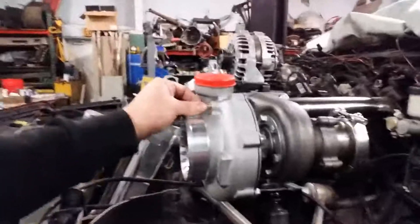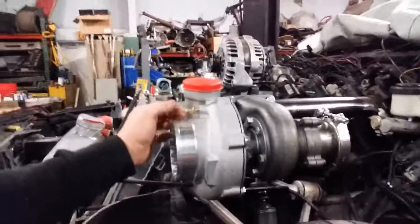This right here is for a manual or electronic boost controller. A boost controller's biggest job is to literally limit how much boost pressure this turbo is going to make. You can have a manual — just a little knob, a simple thing. You sit there and spin it — think of it like a water fountain or a garden hose nozzle. You just spin that boost controller down or up: boost levels down, boost levels up, meaning water flow down, water flow up.